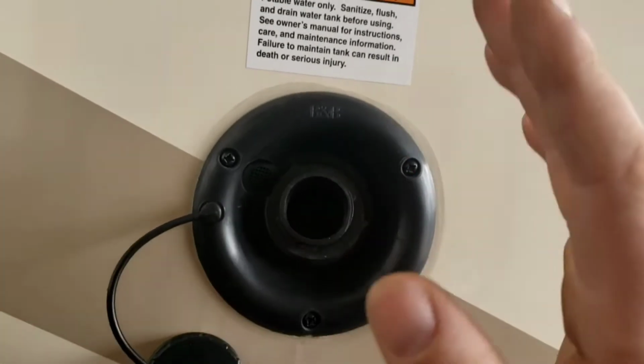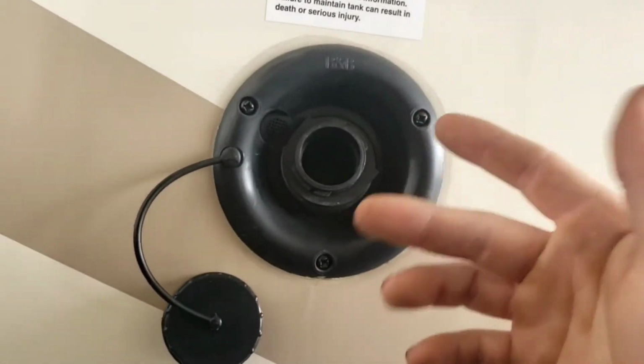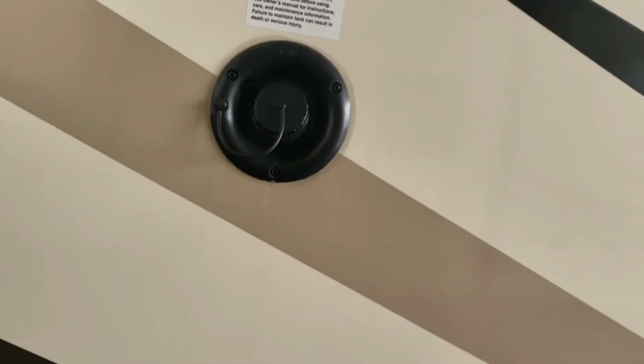Don't jam your hose in there. Just rest it in there. You're not trying to pressurize it. And then when you see water squirting out of here, you know you're full. It'll come out here and around the hose. But I don't like it to get to that point. I always monitor its progress on the monitoring panel inside. So I stop as soon as it says full.